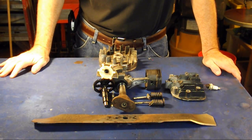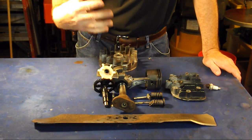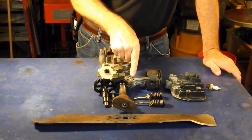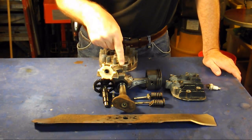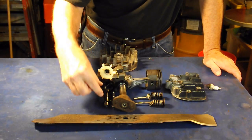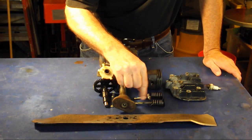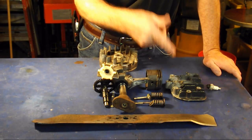This is a 3D representation of our engine that we just took apart. We have the flywheel and the lawnmower blade for the mass to keep this thing going. We have a crankshaft with our piston and our connecting rod. We have a gear here that is half the radius of this gear — this is our camshaft gear — and this is our oil slinger. The camshaft moves our two tappets that push up and down our valves, allowing fuel into the head and exhaust out of the head.